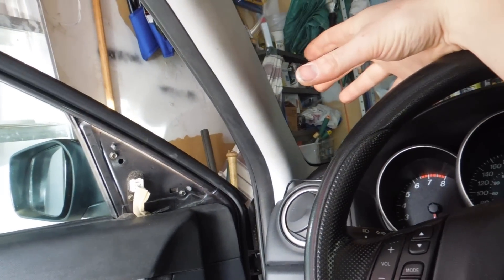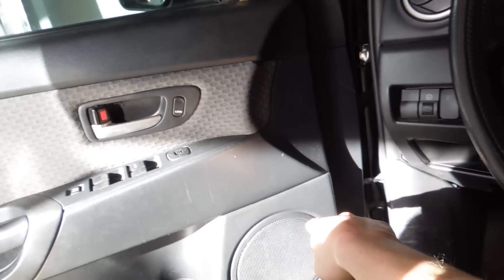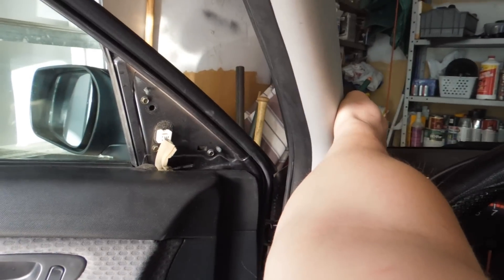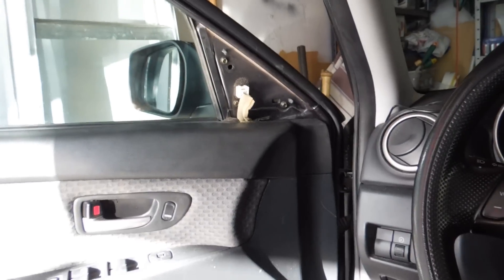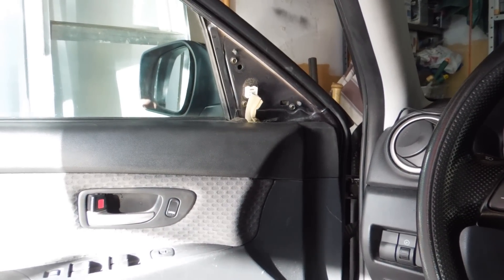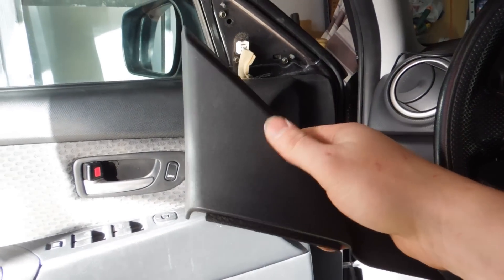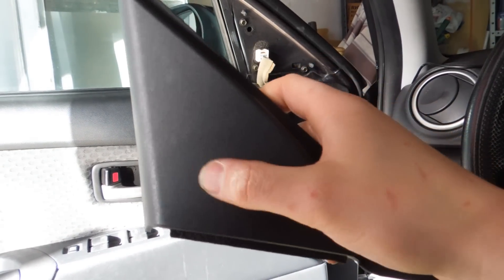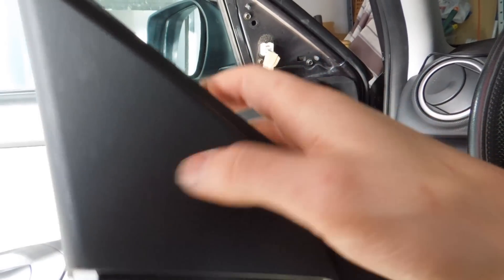Basically, the best way to find the perfect sound in your car is double-sided sticky tape. Connect it when you have your door panel off — hook it in with your woofer and the crossover, put it on the crossover, and then put it on here with some double-sided sticky tape and on the pillar. Just see which place you like the sound the best. I'm going to go inside now that I've got my pillar, and I'm going to decide where I want it. I've got some hole saw kits, so I'll match up the hole saw with the size of the tweeter, then bang that through and grab the one from the other side so we can make a match.